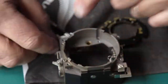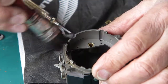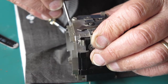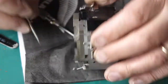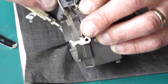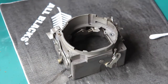It just allows me to put that plate back in the front without any great fight. I can see that had a little spacer washer either side. Now all of this stuff needs to be cleaned. There's certainly some corrosion there, and something here — I don't know whether that's dried-out grease, but if it is, it's gone like concrete — a very dry wax now. I want all that rubbed off before I put anything back in the housing. I'll just spend five minutes cleaning this with naphtha, and you can watch me put it all back together.